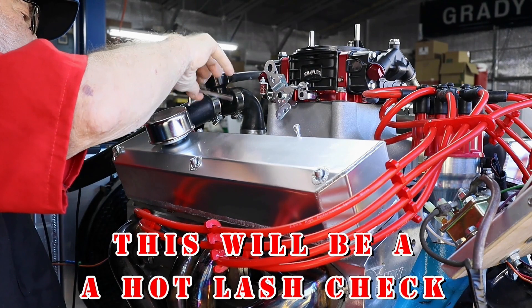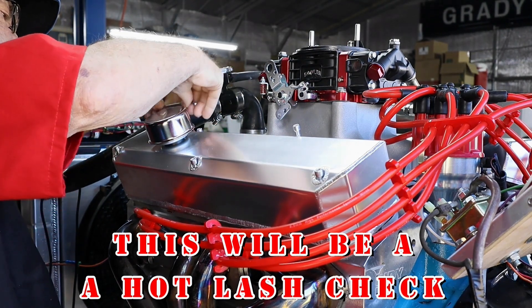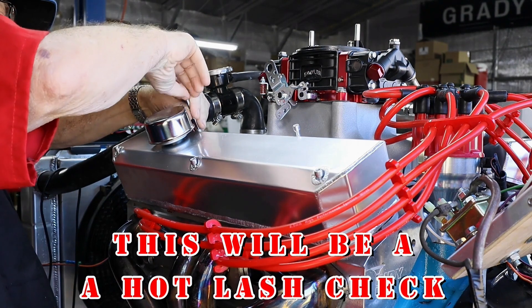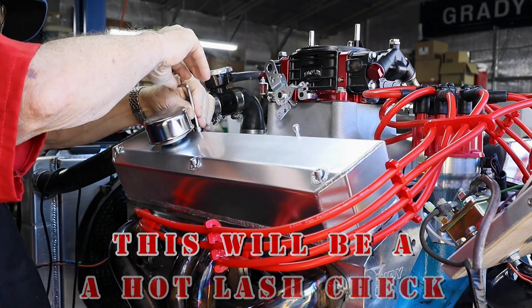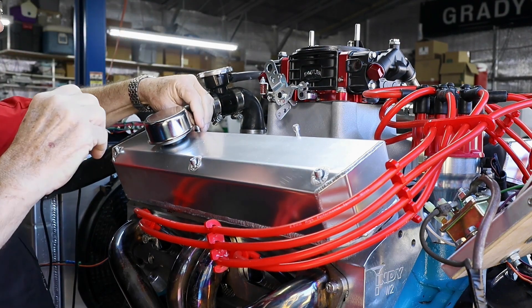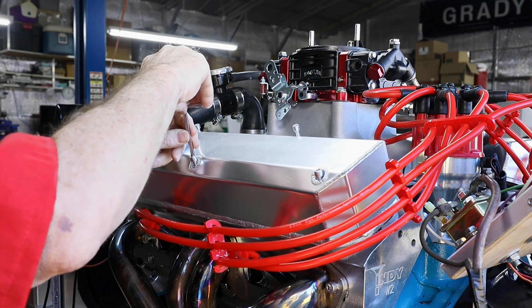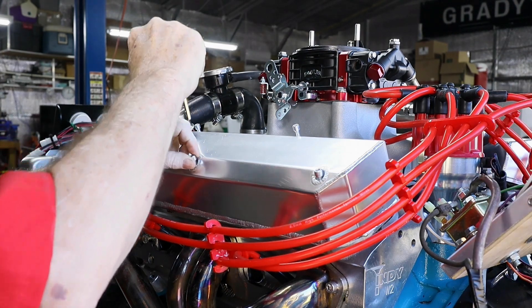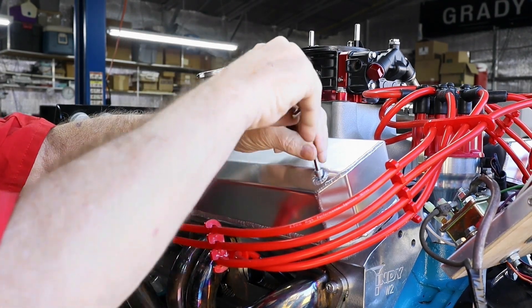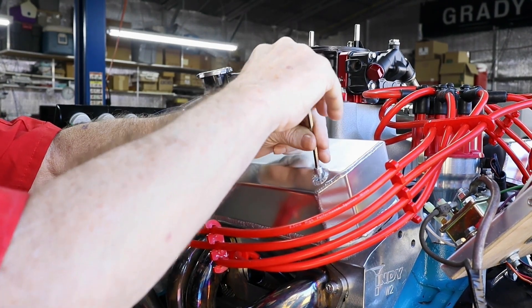Now we are checking the lashing to make sure that we are good for the recommended lashing cycle. If we need to adjust that we can adjust that. But our objective here is to receive zero lash now that it's been heated up — when heated up it should be zero. So we're taking these valve covers off right after it's been running, so it's going to be kind of warm. We're going to be checking the driver's side bank and see what we find.